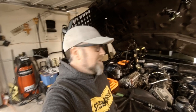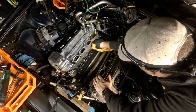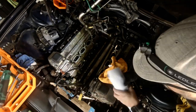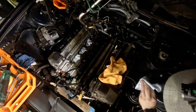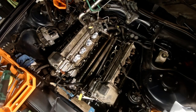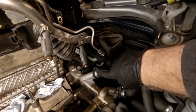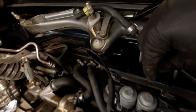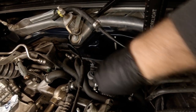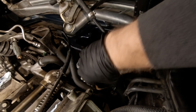We've got a lot of cleaning to do — it's pretty gunky, not a huge surprise but a bit of a disappointment. Next we need to remove the accumulator — also called the crossover pipe — and then the heater control valve and the auxiliary pump assembly along with all the hard and flexible pipes associated with them, so we can get the valley pan off. We'll start with the three pipes for the HCV, beginning with the one at the accumulator, then the two going into the cabin to the heater. There are two power plugs on the HCV assembly.